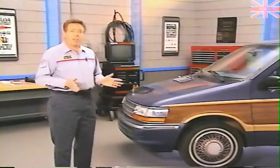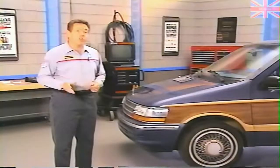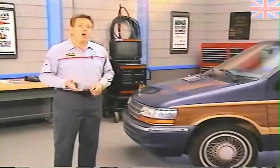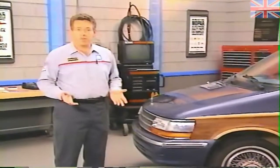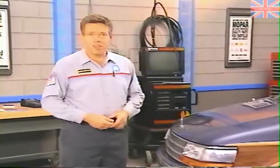One condition you may encounter on the Bendix Antilock 10 system is a master cylinder seal leak. With this condition, the yellow ABS warning lamp and the red brake warning lamp will be illuminated. In addition, the pump motor will run continuously, or in a few cases, will cycle on and off frequently. A low accumulator fault will also be set.